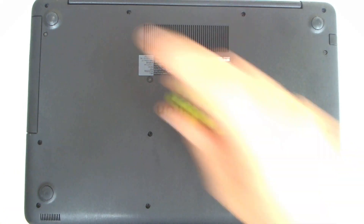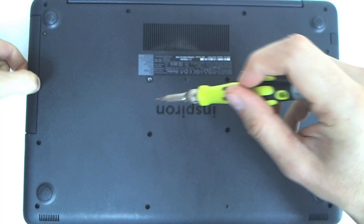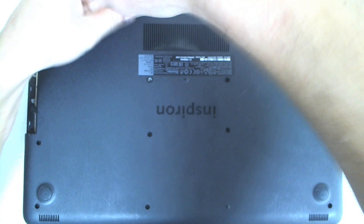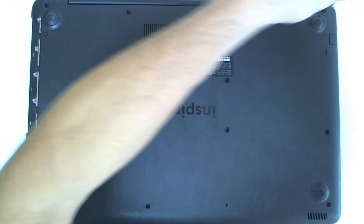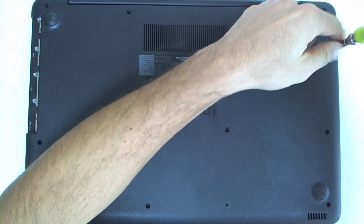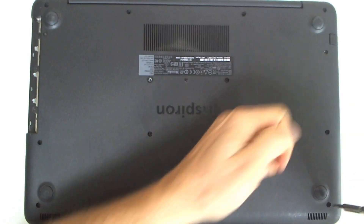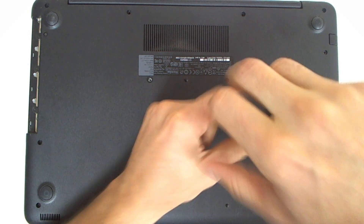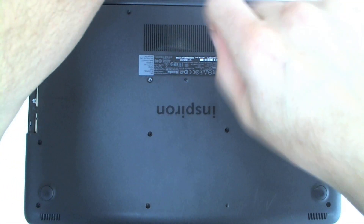The first thing of course, we're gonna remove all the screws from the back starting with the optical drive. The screws should be the same size. I haven't opened this model lately, we'll see. Probably the upper cover with the keyboard is coming off since there is no service holes on the back. Also there are three screws under the optical drive so don't forget about them.